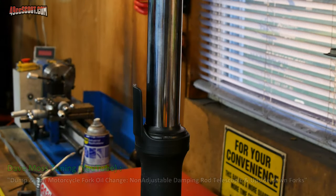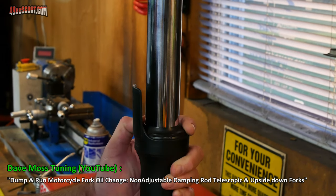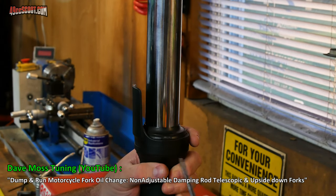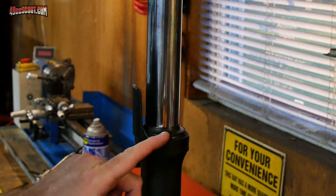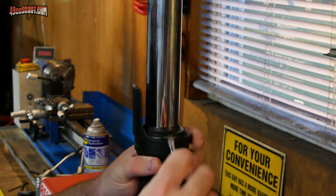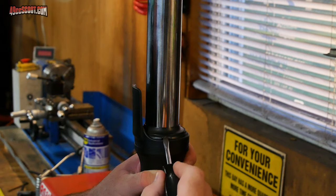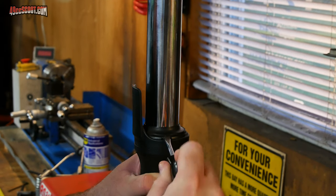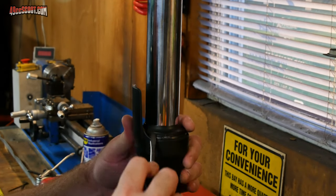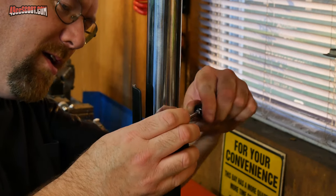I've seen a method from Dave Moss Tuning, and I'll put a link to that in the description, that he says allows you to pull some grease into the fork seal, not the dust cap here, but the actual fork seal down here. And to do that, first I need to remove this dust cap, get that up out of the way a little bit. So I'm just going to take a flathead screwdriver, and they've got this little access point down here, this opening, and carefully push that in. You don't want to damage this seal, and get this thing worked up and out of my way. And you've got to work all the way around here.